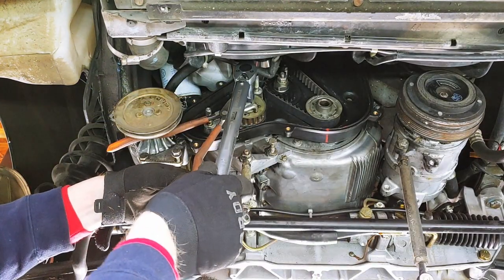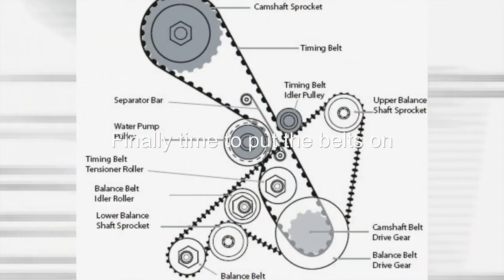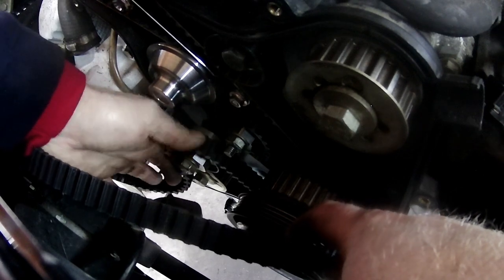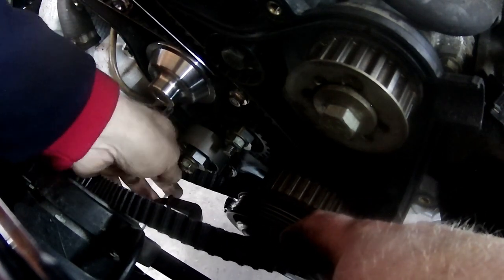Then I was finally ready to install belts and rollers. Here we're looking at the belt routing diagram — for info like this I recommend ClarksGarage.com. I installed the timing belt around the crank gear and the cam gear, the new tensioner and the new updated belt roller. I kept an eye on the cam mark to make sure it didn't move once the belt tightened up, then did an initial tension and moved on to the balance belt.